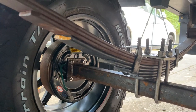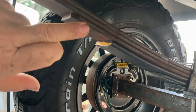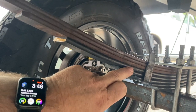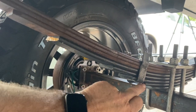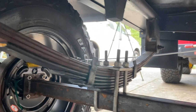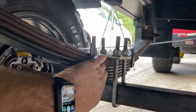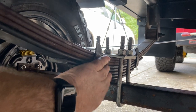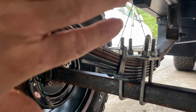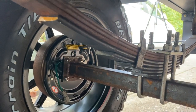This is what we've ended up with on the camper trailer. The military wrap on the second leaf of the original spring pack we've kept, and the leaf further down I've kept. From then on I've put in some 8 millimetre springs from a spring set that I purchased off eBay — I think they were $100 a pair, so they were cheap. These 8 millimetre springs — the complete spring pack was supposed to have a 1500 kilo rating. However, by not using all of the springs we've brought that rating down. It's provided a bit more arc in the original spring pack but mostly it's stiffened up the load carrying of it.